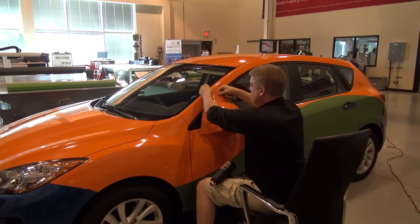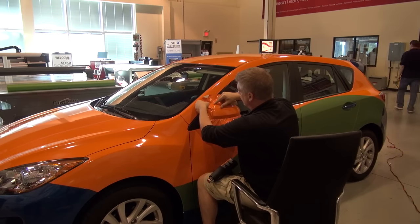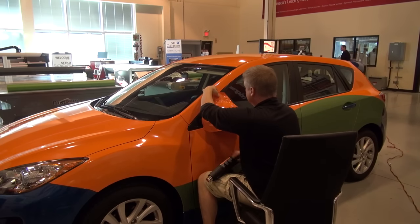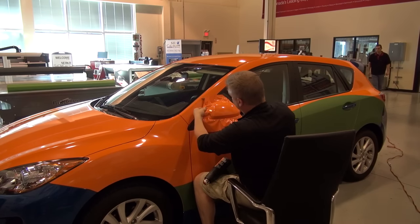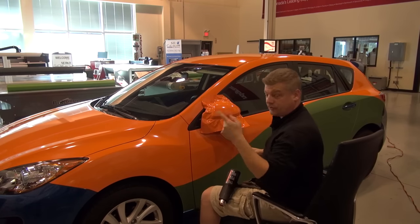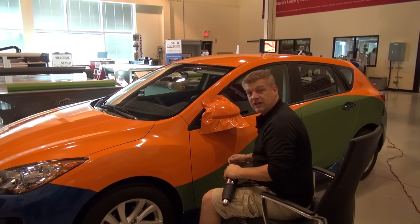Same here, now I'm going to do the corner first. I'm going to open it up, not pulling, just relaxing, okay? I'm going to open this corner up, work 50 one way, and then 50 the other way. I'm going to nicely spread that corner or problem area out. Now all that's left is to trim up, re-squeegee, re-squeegee, re-squeegee, and then let it sit for 12 hours overnight to allow those acrylic adhesives to really bond fully to that substrate.